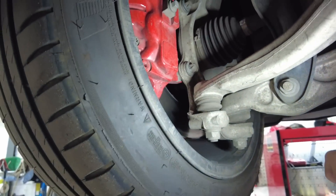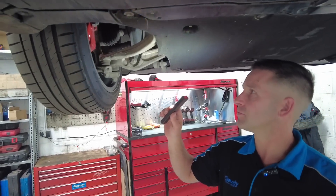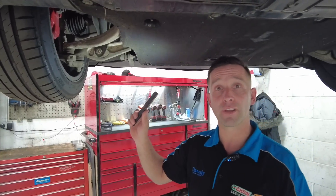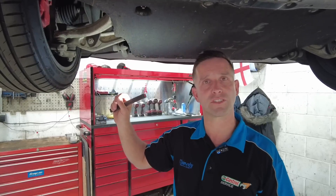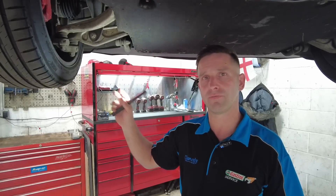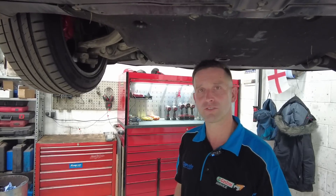You can see the red calipers — I always forget they're on there, hidden in stealth mode behind the wheel covers. The rear pads are around about three mil. Tesla pads have acoustic wear sensors, which is just a metal shim, so you'll hear screeching but the pad still has life and it's still going to brake — it's not unsafe. Rear pads wear slower than the fronts, so you may get a few thousand, maybe five thousand miles more. It's worth thinking about whether it's time for a performance pad upgrade, especially now I'm doing more track-type events.